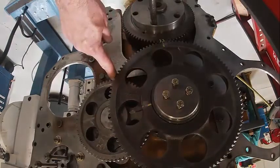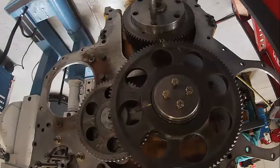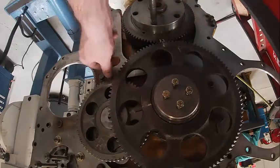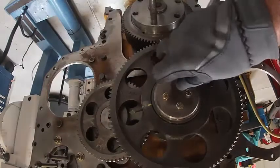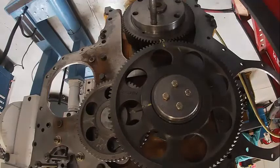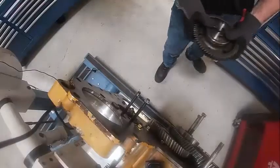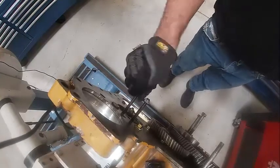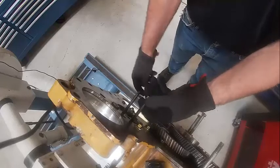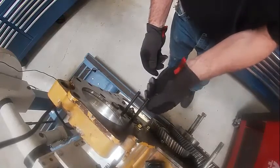There's a mark here and here. You can also see a K here and a K here when it's on top dead center. We'll also need to time our fuel injection pump, but that's done after we get the flywheel housing on and the flywheel so we can pin the flywheel on top dead center number one. But like I said, this is critical — this is lined up, these are lined up, and there's a K here and a K here. Torque our cam bolts. I also need to put some lube behind this before I put it on. We're going to put our idler gear on. This gear comes from the cam gear up to the air compressor drive. Right down here would be the fuel pump gear, and that's timed to the engine as well — not through marks though, it's done a little bit differently.